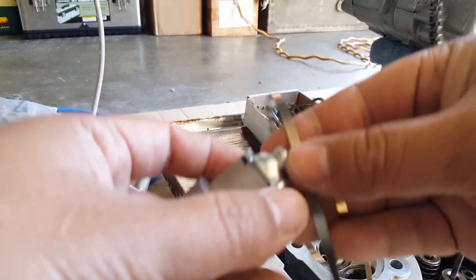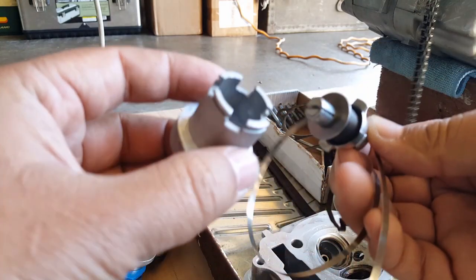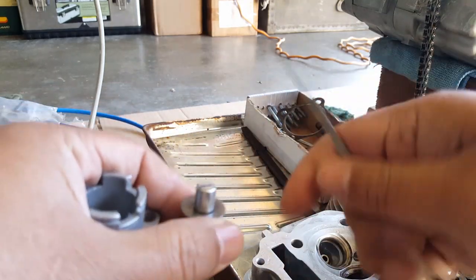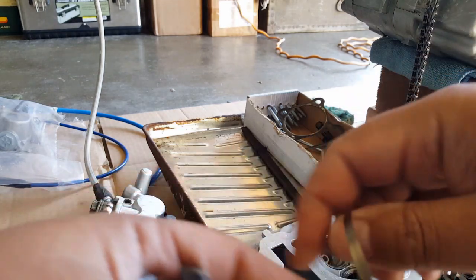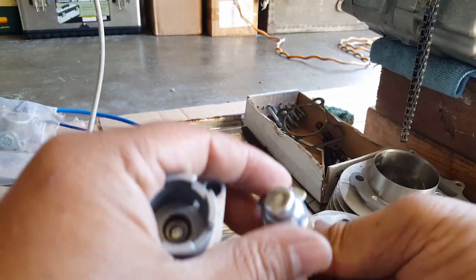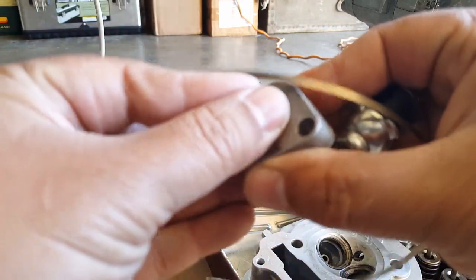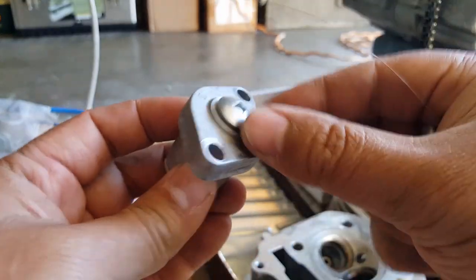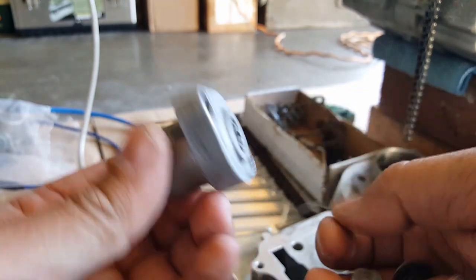And when it comes off, there's going to be a spiral inside of it wound up already. So that's pretty much what the inside of your cam chain tensioner looks like. This spiral right here, it starts out like this, and then it just keeps winding itself in. So when you wind the Phillips, when you get this guy off, you'll see here. I thought it was pretty neat that you can actually just take it off. And maybe if you're really careful and skilled, you could take it off and clean it really internally.